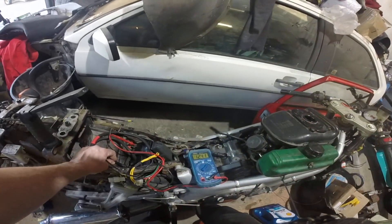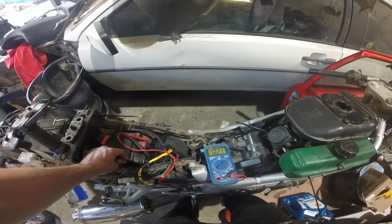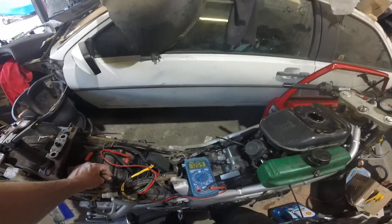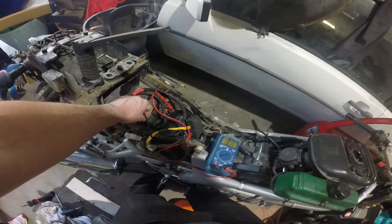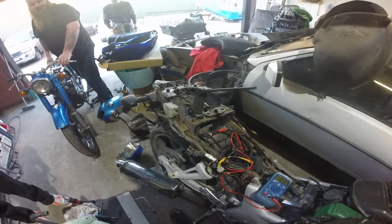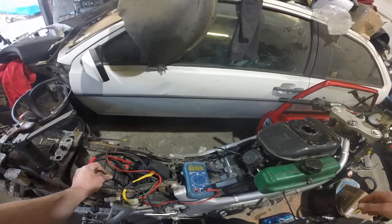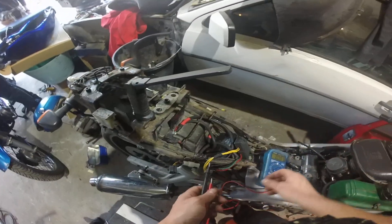It's all plugged in and wired up into the SV loom now, but with a CBR600 rectifier. We've got wiring! It's charging! Thirteen and a bit volts going in. Woohoo — fixed it, it's charging!